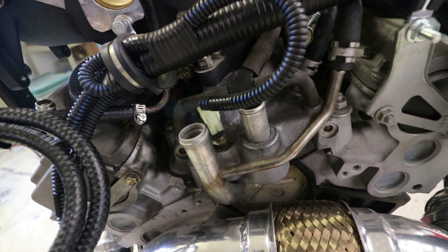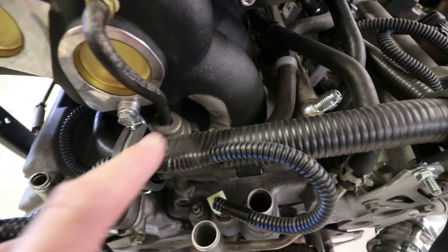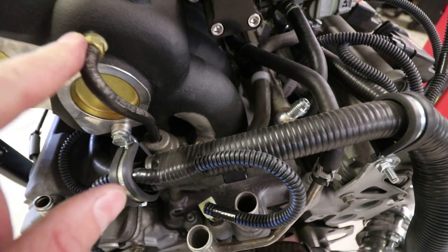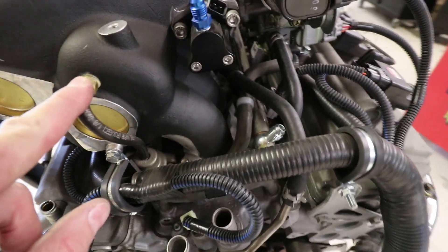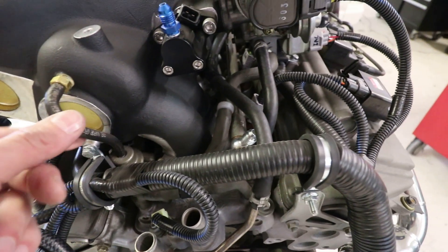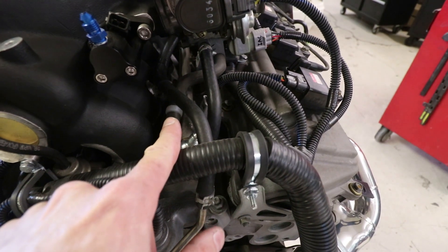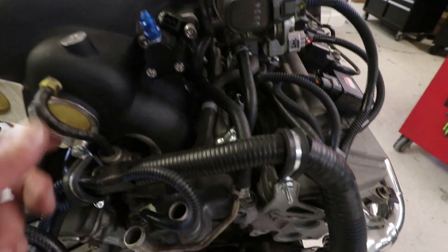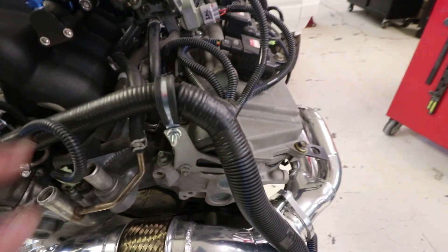We like to install that fuel return hose ahead of time because it's a bit difficult to get to with the engine in the vehicle. Back here towards the top of the fuel pressure regulator there's always a hard vacuum line that needs to be connected with vacuum hose. This is a great place to connect it, particularly with forced induction. There's a similar fitting on a factory plenum in most cases which can be teed into factory setups, but for naturally aspirated vehicles, nice to have that vacuum hose hooked up ahead of time.